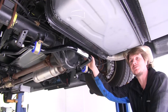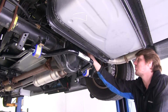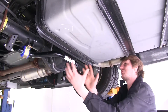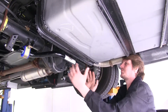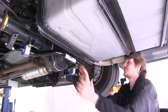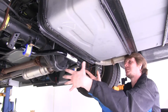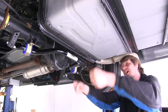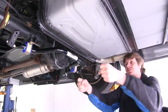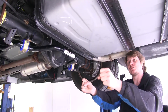An additional component to help out your suspension and steering is a track bar. We don't have that installed, but it will connect between your differential and your frame. While your sway bar helps to prevent body roll, the track bar helps prevent that tail wag. The tail wag can be a big factor that causes body roll, so having both will help reduce it drastically. When you have tail wag in the back, you're in the front having to compensate for that in your steering. Preventing that tail wag is going to drastically reduce driver fatigue so you can maintain a nice, steady, straight path.